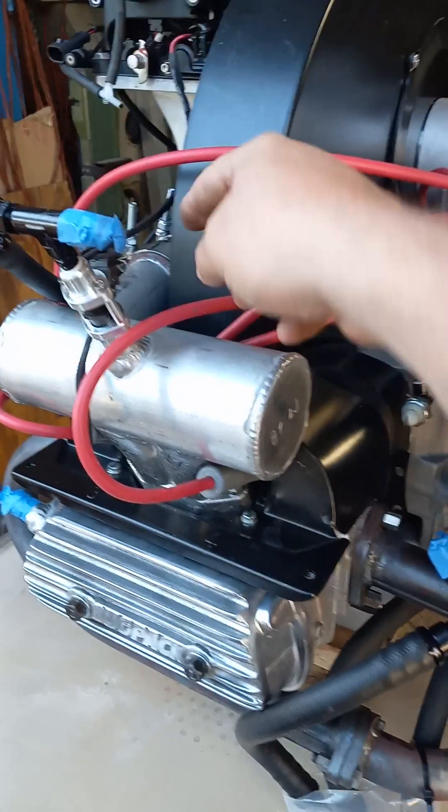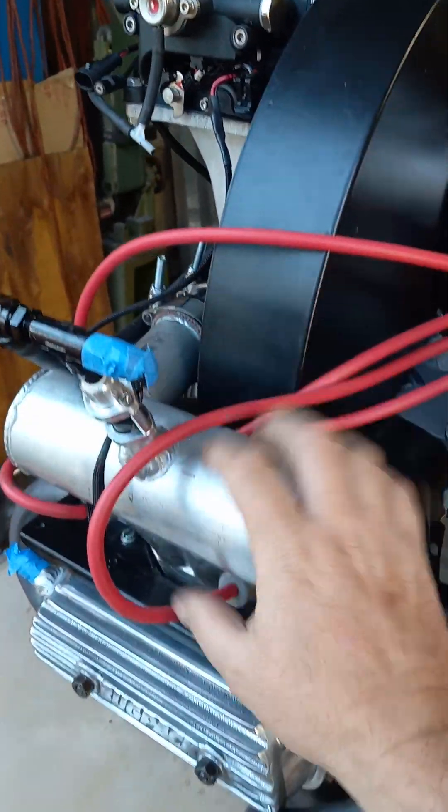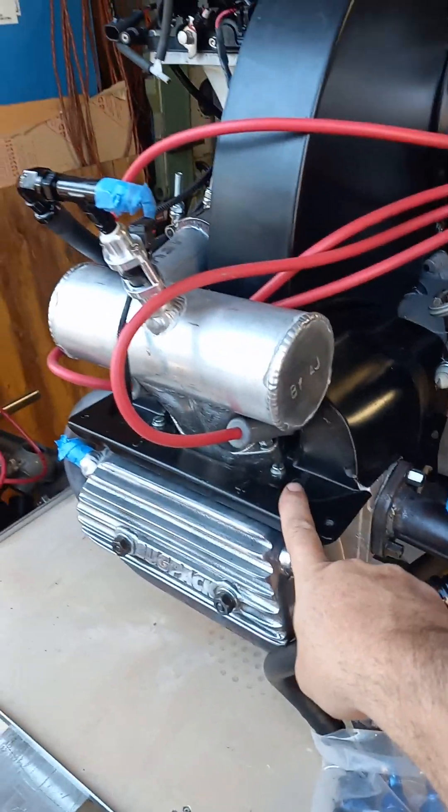Some of the things I did: of course plenums. I did two inch into the plenums, three inch into the manifolds. It's got big — I think it's 4237 — CNC ported heads.